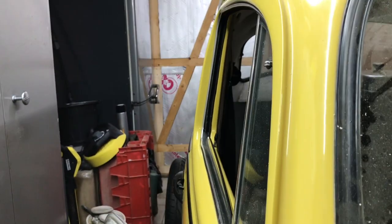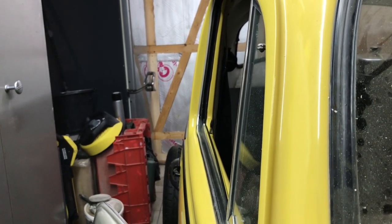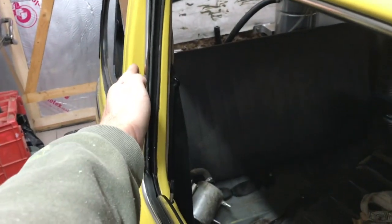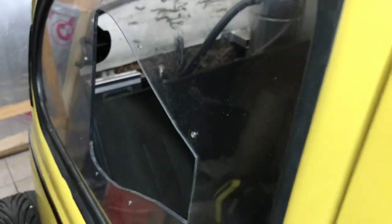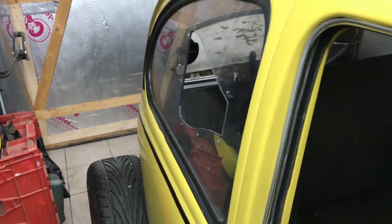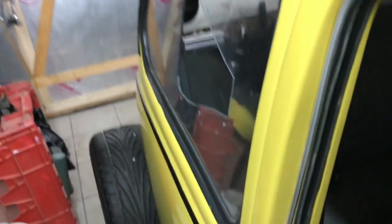If you look along the side of the car, I can't see any sort of air intake. What I believe is the air was probably hitting the door pillar and bouncing off, so not much air was getting into the ducting. I do plan to still use this ducting but for another reason, and I plan to add a scoop that comes out further than the door pillar to catch more air and direct it into the air scoops.